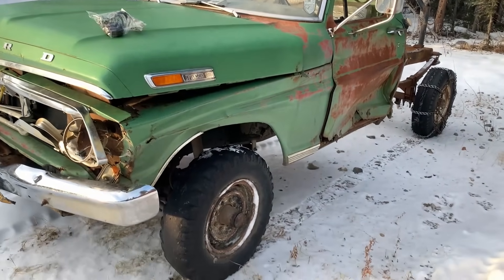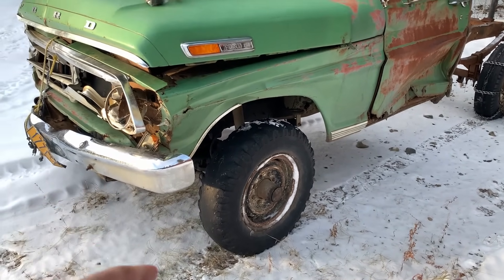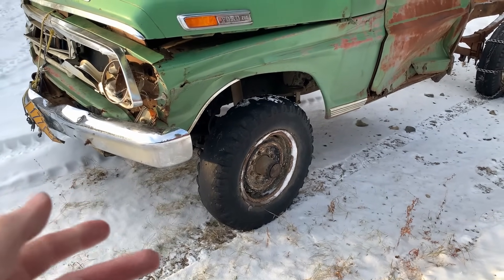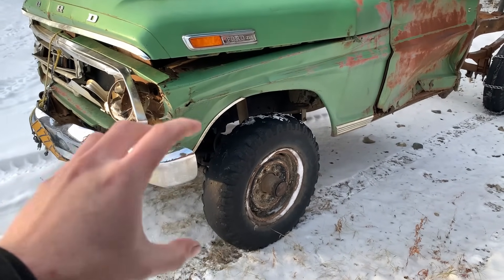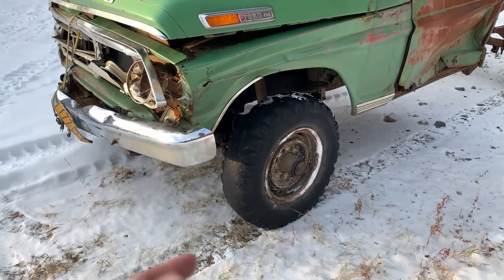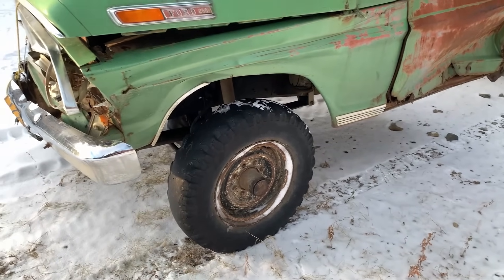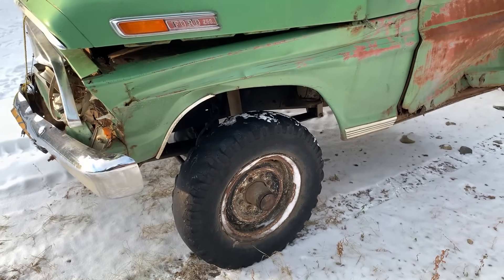Got the boom truck out of the shop. We kind of jumped ahead and skipped over some stuff, but I scratched my whole idea on making the front differential work. I messed around with it some more and found out that the relationship between the ring gear and the pinion gear are not all that great anymore. The teeth look fine visibly, but the engagement between the two is not so good. As you probably recall, when we were turning the yoke before we even opened that thing up, it kind of skips. Without correcting that with all new stuff and bearings and everything, once a front drive shaft is put back in it and power is applied, it's just going to skip and not engage right and work properly. So why waste the time to weld it up and do all that stuff I was going to do?